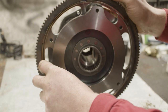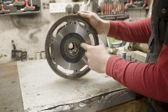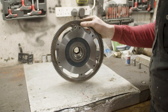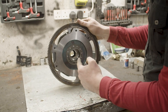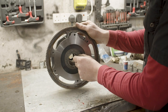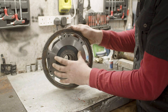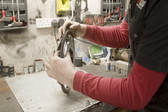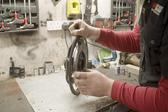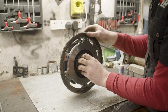Some people call these horns but ears or horns, it doesn't really make a difference. This is the pressure plate. In the very middle here is the clutch plate and it's attached to the primary gear. The primary gear drives an idle gear which drives the gearbox, so you have drive coming from the crankshaft which is attached to this flywheel. The clutch plate floats in the middle on the primary gear when everything is clamped together. The pressure plate is squeezed against the flywheel by the diaphragm.